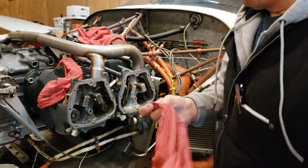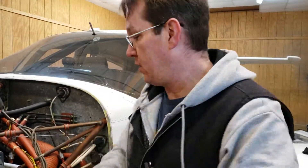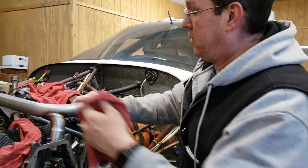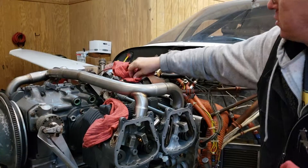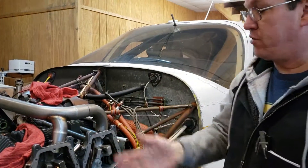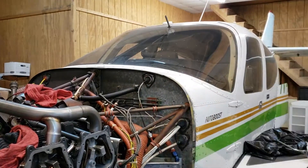The only thing remaining at this point is going to be to finish torquing down the base nuts. And as we do, everything will just kind of squeeze in together and go right where it belongs. We'll get all the torque values in, complete with rocker arms — no headaches. Fewer headaches than trying to get the base nuts on for the exhaust. The exhaust is firmly in place, and we should be able to repeat this process again using the spring compression tool — go all the way around the entire engine, just get everything put in, and we're in business. So that proves my theory. Now you know, and you can employ it if you're crazy enough to.